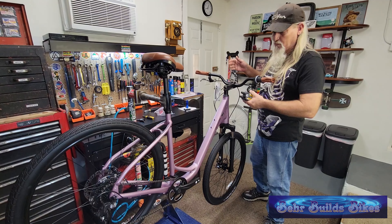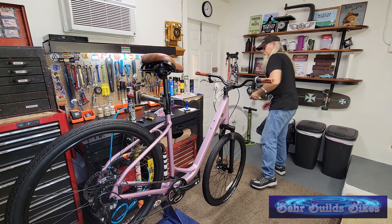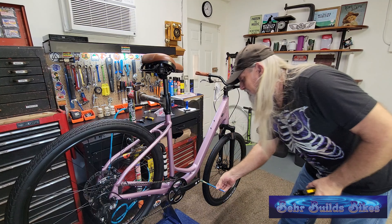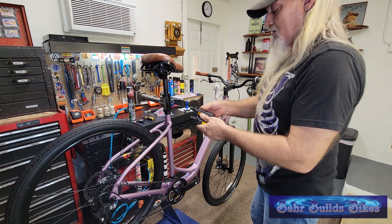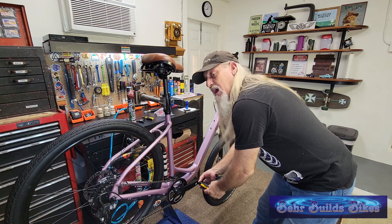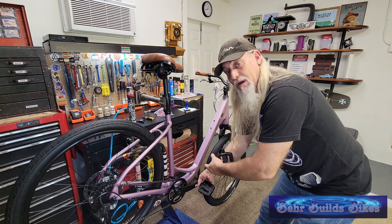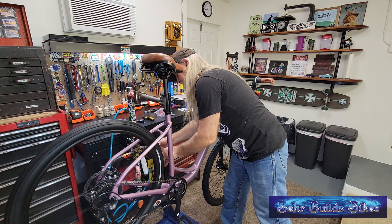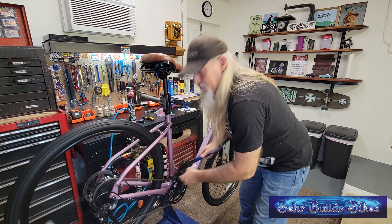Since we're moving towards the rear of the bike, the next thing we'll do is unpack and install the pedals. A little grease on the spindles and grease in the crank arm. These particular ones aren't stamped but they have stickers on them — right side, clockwise motion to get it started. Once the threads start to pick up, move on to the next one, then with our 15-millimeter pedal wrench we pedal backwards to seat the pedals very well — press down.